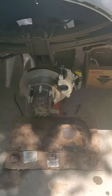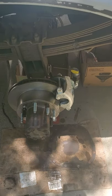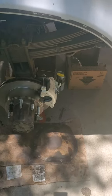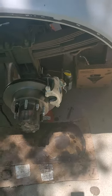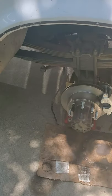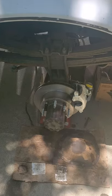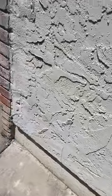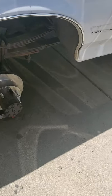While I was at it, I went ahead and got a new rear diff cover — I'll show another video after I get it all buttoned up. I got the Ford replacement with the fins on it. But that's where I'm at and that's what it looks like. For those who have the Sterling 10.5 and an old-body-style Ford F-350 and are sick of those drums — this is it. It'll probably cost you about $1,000 or so, give or take, depending on if you need to buy a new hub like I did. If you're a novice like myself doing it in increments, you could probably sit down and do this in about a day or two with the help of somebody else. Hopefully this is helpful in your endeavors for you old-body Ford folks.